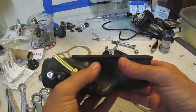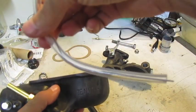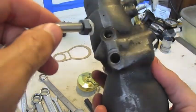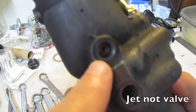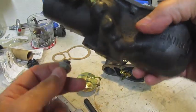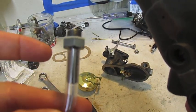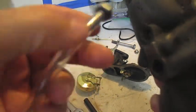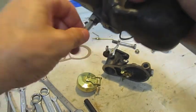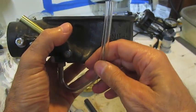You can't see through your carburetor, so how do you set the proper level? There's a handy little tool that Model A parts stores sell — it's a clear tube with a little wire inside. This end screws into the bottom here where you'd normally drain the carburetor. It's a modified fitting with a washer — you just screw it in like this. When it's screwed in all the way and you fill up with gas, the wire inside can be bent to help you read the level.